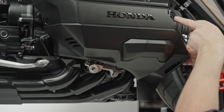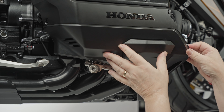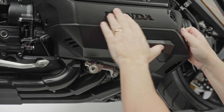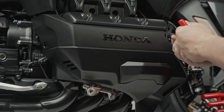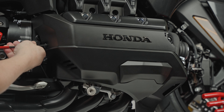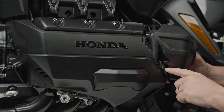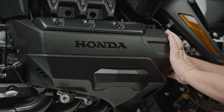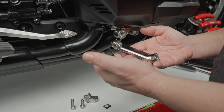Now that's slid back in place — you can see because the hole lines up on the top. Make sure your clips are on the inside, and that clips together. Now push the center piece here until it makes that noise and you can feel it's solid. Remember these two bolt holes are still loose — put the bolt back in here and the one back there. Then put the front cowling back on. The only trick is making sure this little tab goes into this slot first and then this little one goes into the next slot. Give it a little tap, replace the two screws, and that's back together.